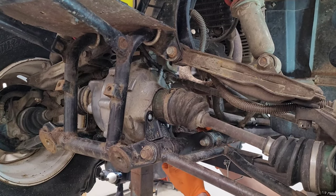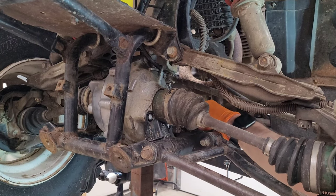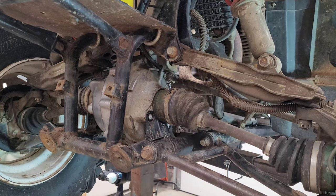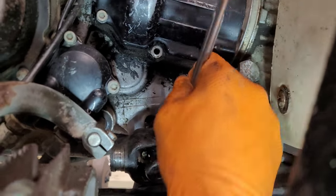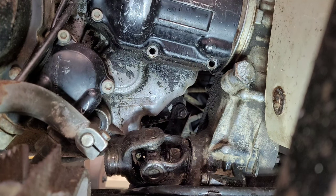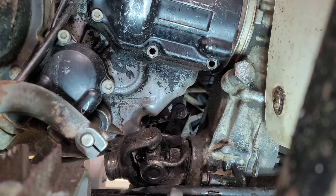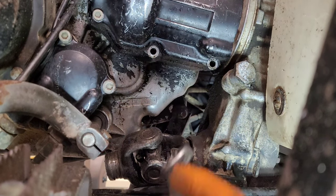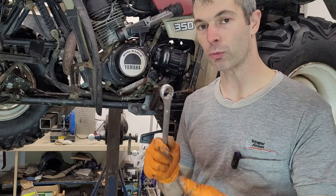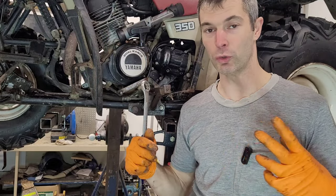After freeing up half the bike I should be able to slide this up and pull this out. Yes, that's looking good. It wants to go this way so we're going to pull it out this way. There's the drive shaft. It's a really tight spot — nothing fits in there. I have tried just about every wrench, every possible combination — crescents, open-end wrenches — and it's just not looking good. I'm going to have to pull this off again. So if you're in this situation where you have to either do a U-joint or the seal on that output shaft, do both.